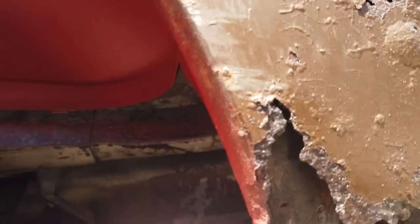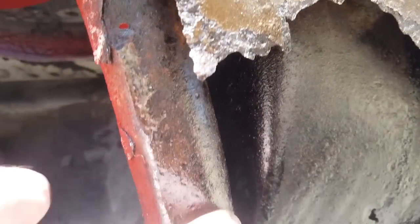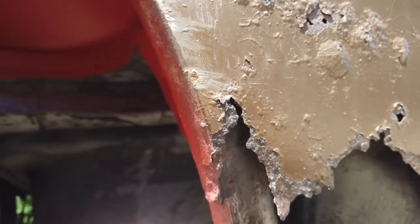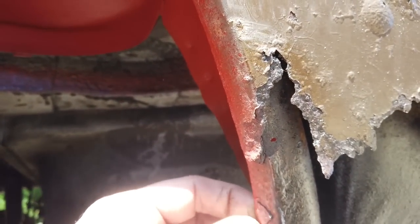So it's a slight mod there, but it's an improvement. I know that there'll be some welding, just a couple of welds just on the edge of this lip. The lip's good. When we fit that lower quarter, we may damage that paint finish by doing that weld there if we can't get the spot welder in.